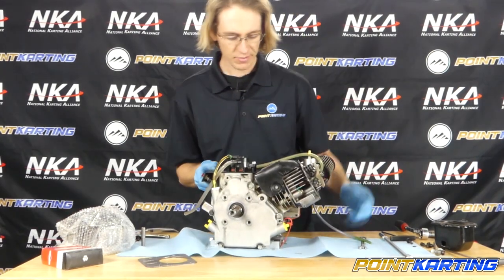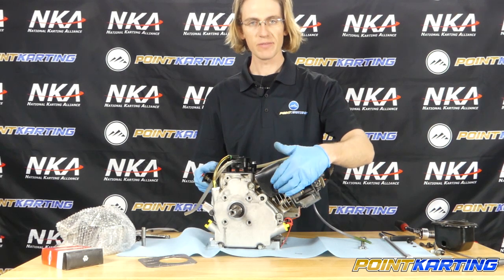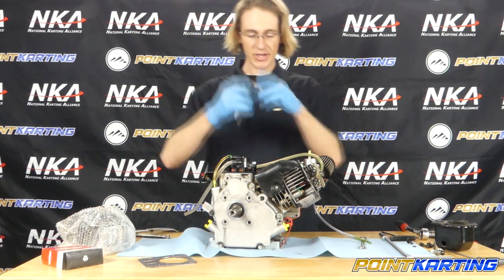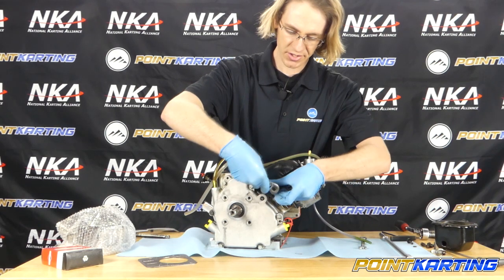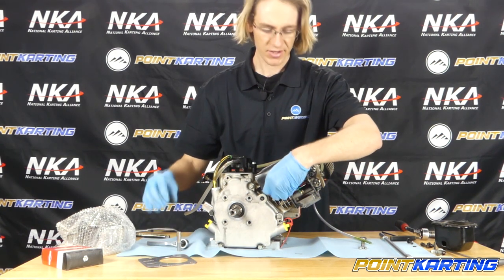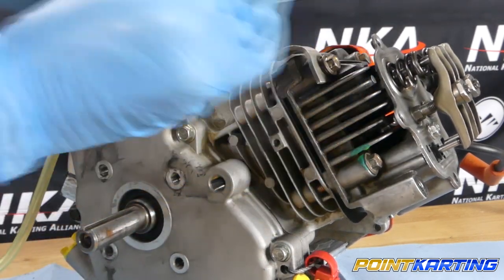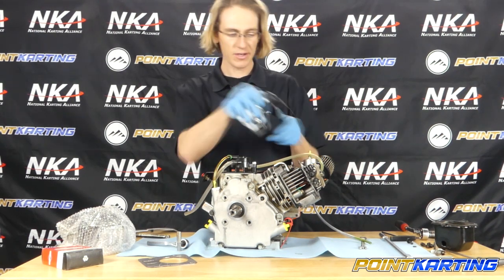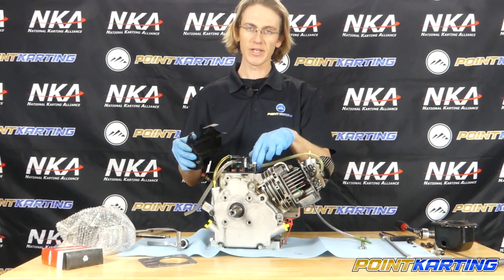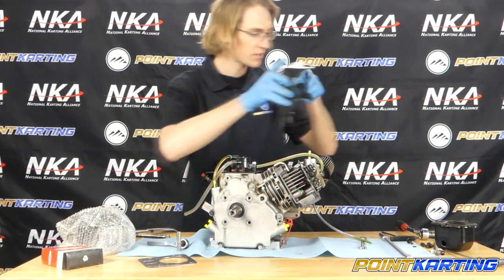For the sake of illustration, I'm going to remove the cylinder shield — a heat shield that is required to be installed on the 206 engine when it's in operation. I'll use my quarter inch drive socket to loosen it, then pull up and knock it sideways. This notch fits underneath the rocker cover plate, so just pull it sideways. Sometimes if they're really stubborn you can pull the top plate loose and move it to the side. I'll set that aside.